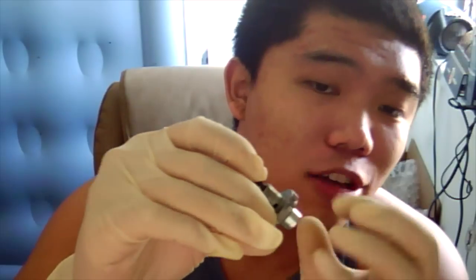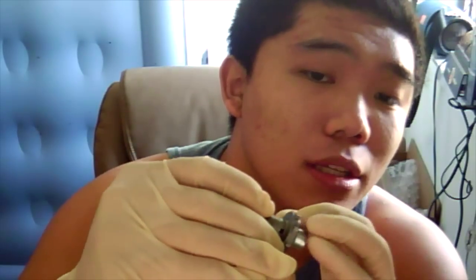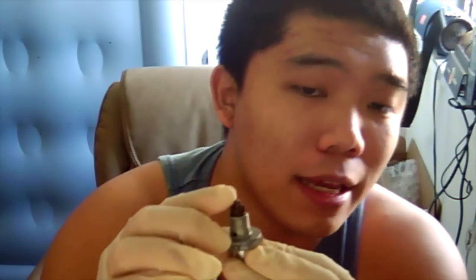When vacuum is high, there's a vacuum chamber on this side that is completely separated by a gasket from the other side. So when manifold vacuum is applied — at idle or even part throttle — the valve will stay closed. This little stem will get sucked down because there's a diaphragm in here and the valve stays closed. But as manifold vacuum drops as you open the throttle more, this valve will start to rise and let in more and more fuel. This being a two-stage power valve means there are two distinct stages — the power valve opens wide and then wider all the way open.